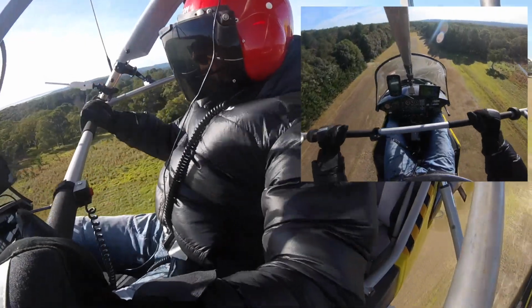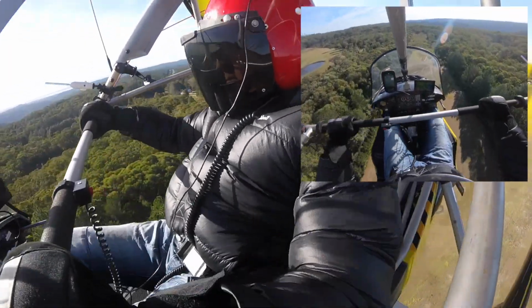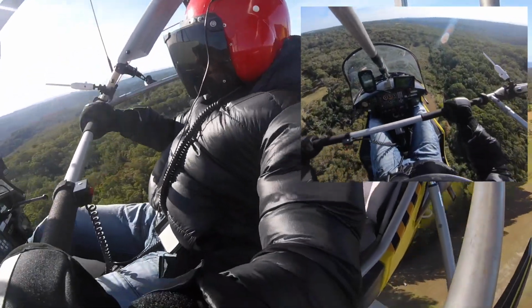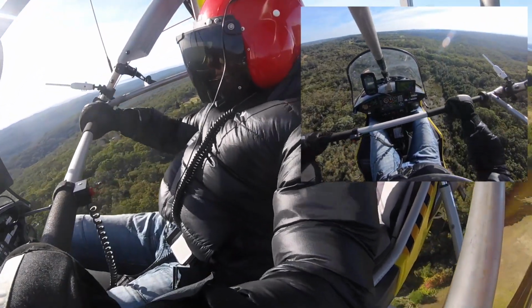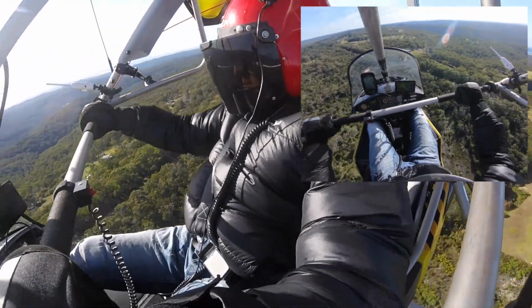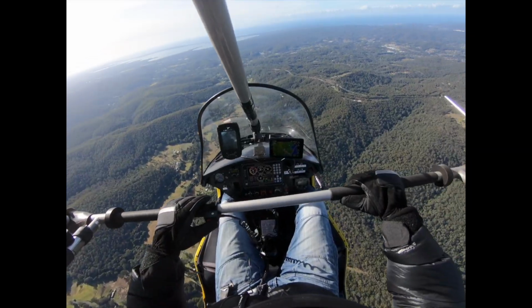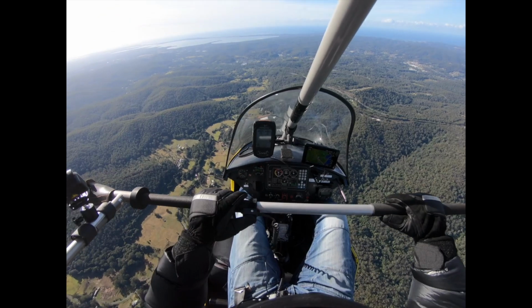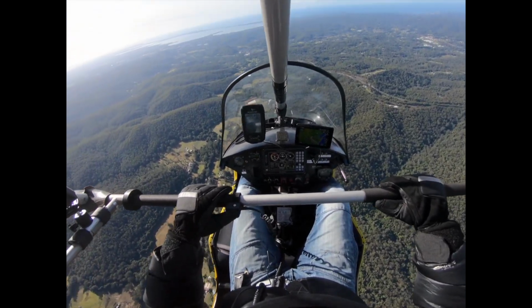And what had happened is that the rubbers for the master cylinders had worn or swelled. I think there's some contamination in the brake fluid I had in there. So I took it down to my local brake bloke, Brisbane Waters Brakes, run by Joe, great bloke. And he managed to find me the rubbers for the master cylinders and also the O-ring seals for the calipers. And I had the whole system overhauled by him. I reinstalled it myself and adjusted it all up, and it works perfectly.